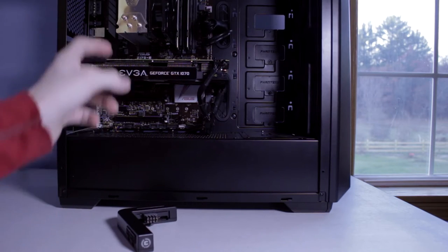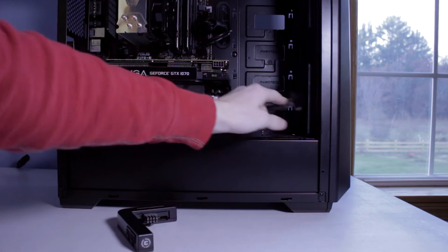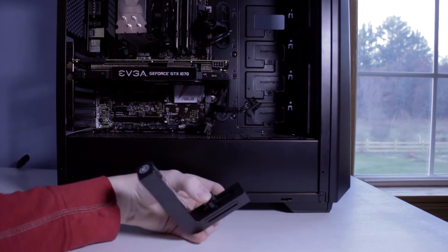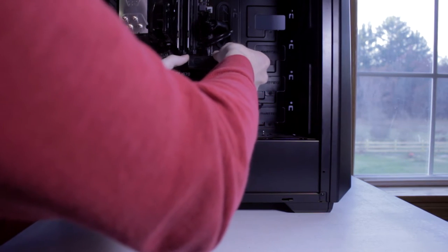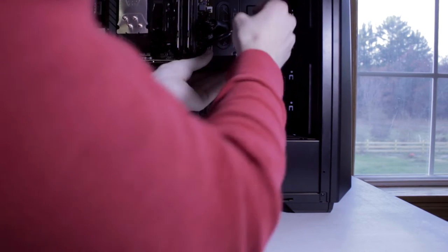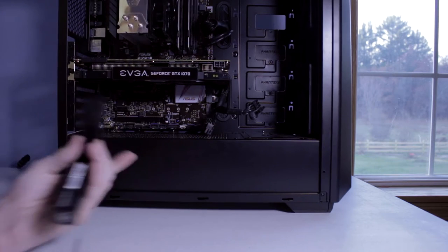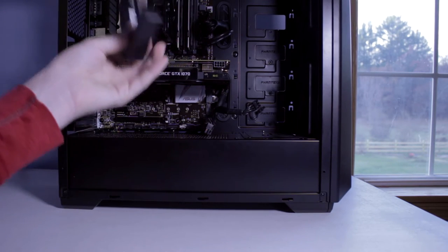The first step is going to be to pull out the plug on our graphics card and try to line this up so we know where to put it. If we stick this into there and roughly line it up where we think it'll look good — personally I like it right up against the edge — we'll find the bolt and tighten that down, then tighten the other one. I should mention I had the bolts loosened before lining it up so I could slide it around freely.